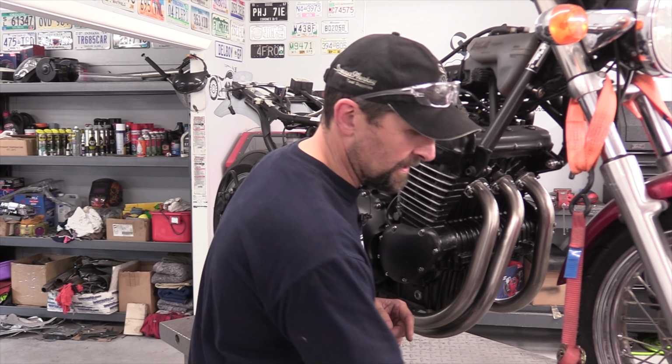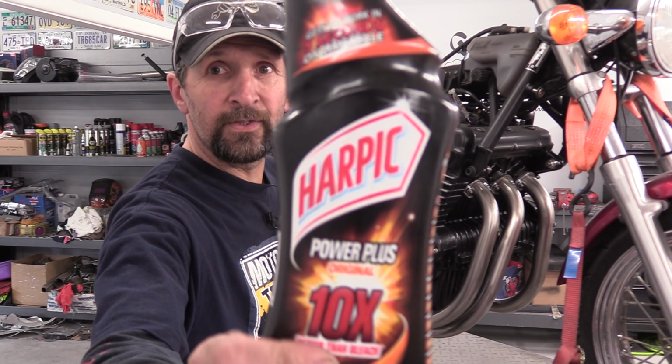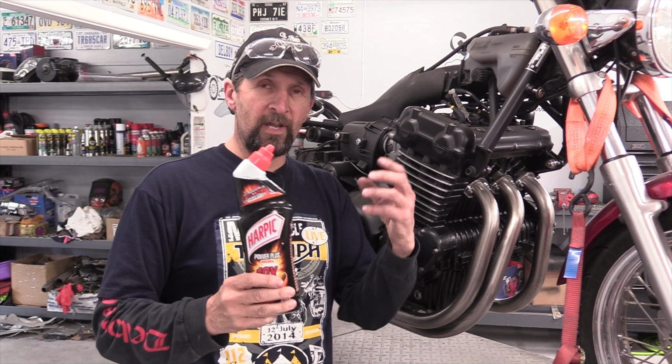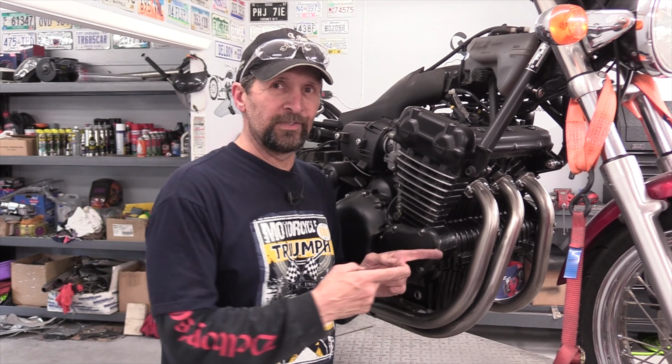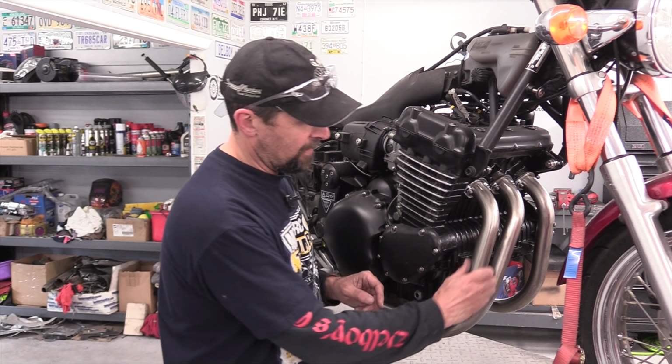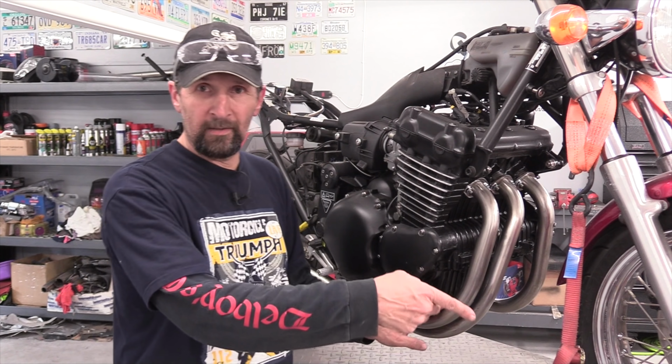One more thing, this. If you're gonna use this to clean your stainless steel, wash it off, because it will continue to act on it. It's a very caustic substance and it will continue to burn into it. Don't let it dry on, because it will never come off. Don't use it on aluminium that's anodized, because it will wash the anodizing off. Don't use it on mild steel, because it will rust it before your eyes. That's quite spectacular. And don't use it on chrome, because it will just burn it off. Only on stainless steel, and on reasonably good quality stainless steel as well, it will bring it up like that, as you saw. And it's a pound in the supermarket.